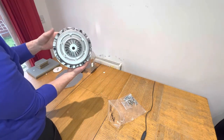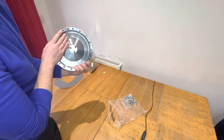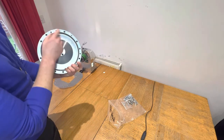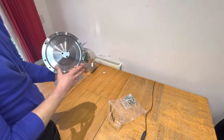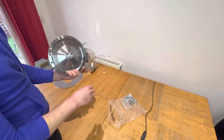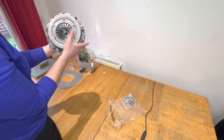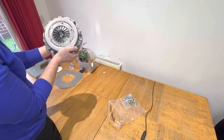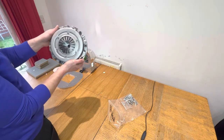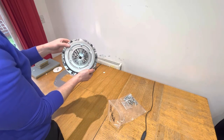This is the pressure plate that comes in the kit — I believe it's from a Nissan Micra — and this here is the flywheel it was bolted to. The flywheel has got three holes in it for the dowels that you'll need to remove from the BMW clutch to put into here, and then this will bolt onto the BMW flywheel. It's got a needle roller bearing in the back, all greased up and ready to go — a really nice bit of kit.